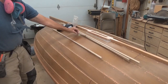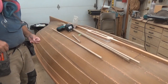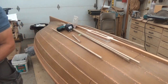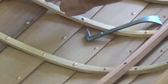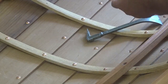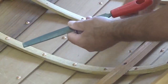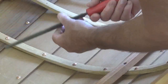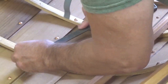Not long enough — I said inch and three quarters, but I need two inches. So I need to remove a couple of rivets in here so I can put on my bilge runners. I don't want to damage my ribs with big power tools, so I'm going to just file the tops off.